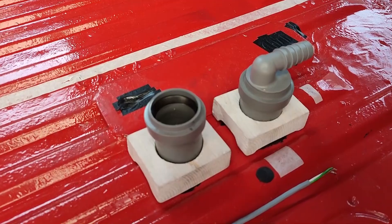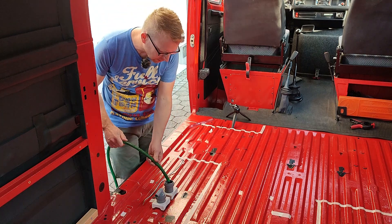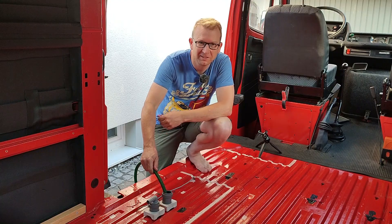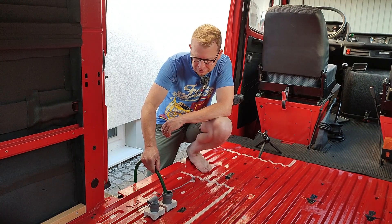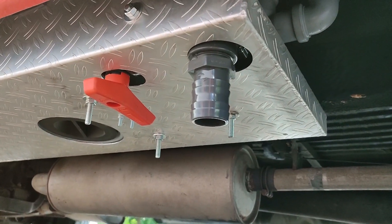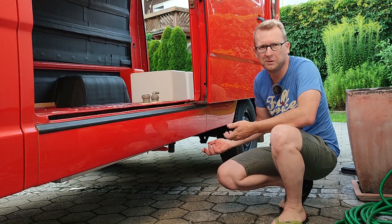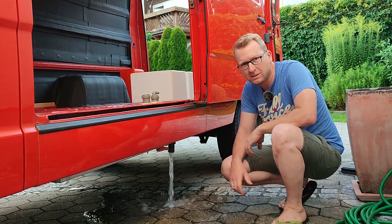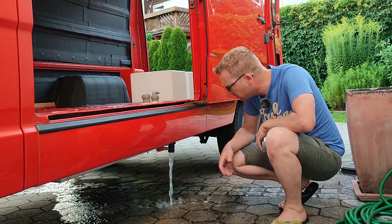The two pipes coming into the van for the sink and toilet are provisionally connected since the floor isn't finished yet, but we can test the system. It seems the water runs into the tank exactly as it should and the non-return valve is installed in the correct direction. Fully filling the tank shows no leaks — even the cap doesn't leak, which is very good. Opening the valve gives a nice strong flow, though I haven't spilled any dummy piss over my hands — unfortunately over my feet.